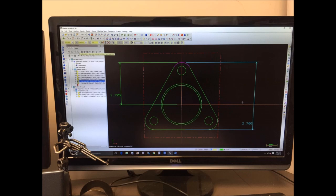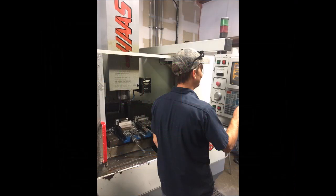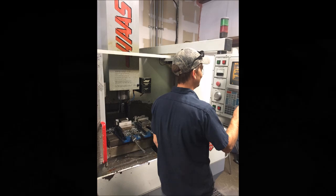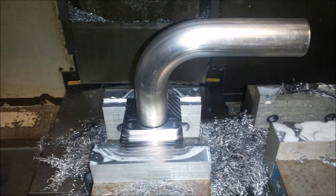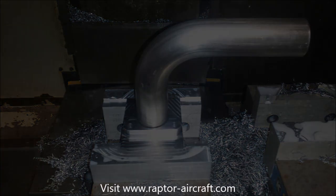Meanwhile over at the engine shop, Doug was having a problem with the flange on the exhaust he'd bought to meet up with the turbo, so they decided to mill one. They're roughing it out on their CNC — actually milling the flange for the exhaust, which is basically going to encapsulate the exhaust pipe, making it much stronger. You can see the pipe sitting in there and they've pretty much got that milled. We should be getting our invoice for the ECU soon as well — so that's our update, thanks for watching.